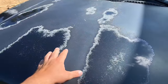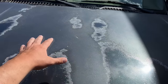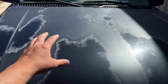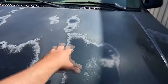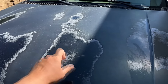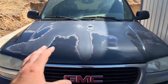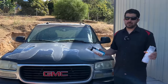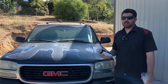Another very important thing to note: if you have dents and dings that you're going to be filling with body filler and adding primer, make sure you use the same or compatible primer with your base coat. You can't use a Rust-Oleum primer from AutoZone, put body filler there, spray that on, and then expect to be able to spray your urethane-based base coat on top of that. You want to use compatible base coat, primer, and clear coats. I'll put links to the compatible products I'm using in the description box and the comment section.